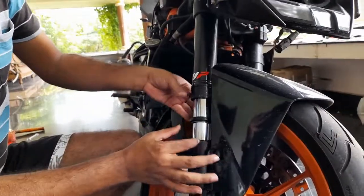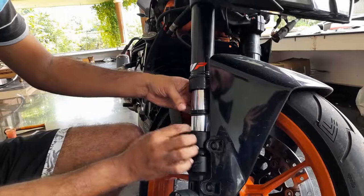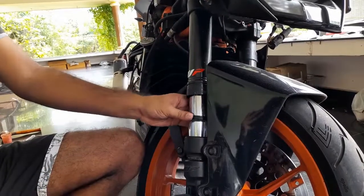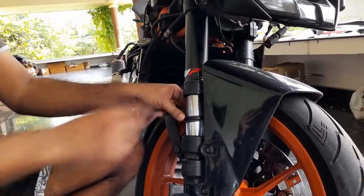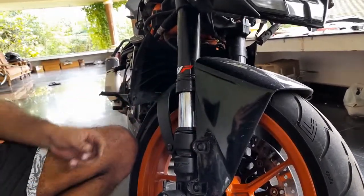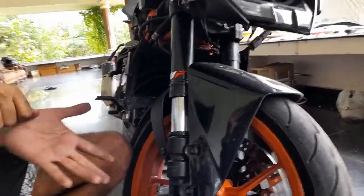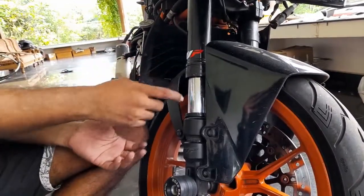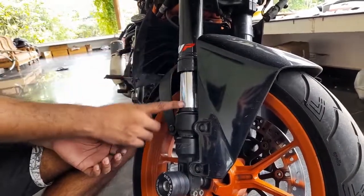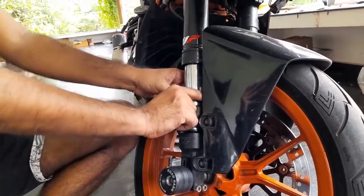See how much effort I have to do. Now I put the ring back. See, when turning it is so hard, because there is no grease — it's grabbing. Like an eraser: when you put force, it has a grip. It should be the opposite of that — friction should be less, it should move smooth. That is why your fork issue has been found out.